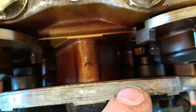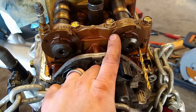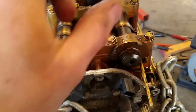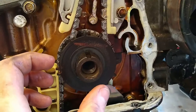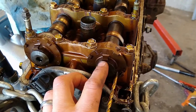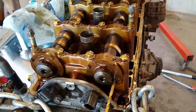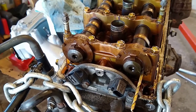I don't really want to take the chance of it seeing that as a gap or something other than a solid piece — probably wouldn't, given how the sensor is set up, but I don't want to risk it. It doesn't really matter which tooth you leave; you're going to take four of the five off. But you don't want it to be in your gap on the crank position sensor. You want to rotate the engine so it's pointing at that tooth, then come back and check which cam tooth is pointing at it — you don't want the cam sync tooth to be in the gap of the crank. I think that causes some issues with how it calculates the angles.